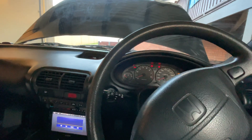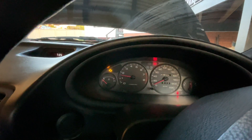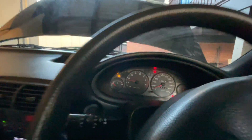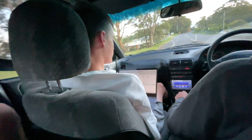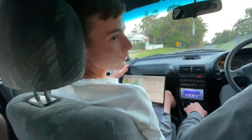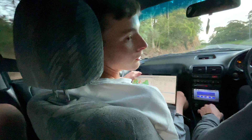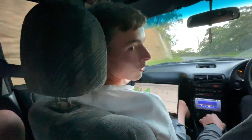I'm going to give it a bit of a start - there we go, she's up and running. Check engine light's on - not sure why that is but I'll look into that. We're just going for a drive now. I've assessed everything and I'm data logging it on my laptop, making sure everything's good - air fuel ratios and everything. When we get home I'll assess it all and see how good it is, and if we need to go back to fix the old issue until we put the VTEC head on.